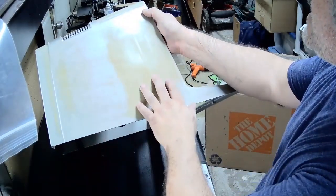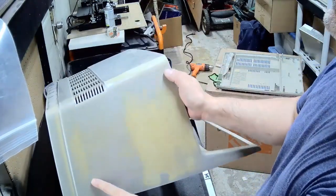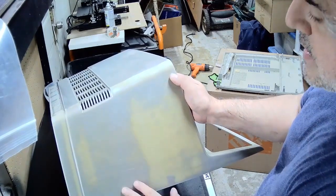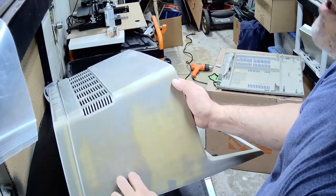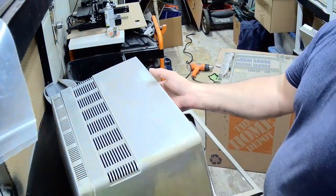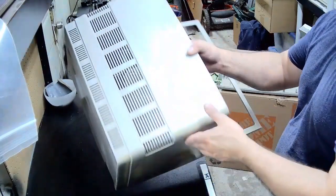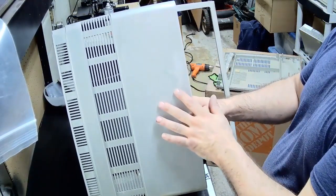Here, they're really, really deep. I had to go to the plastic. These are not deep. The scratch is to the plastic, but my sanding is not, and there's no surface to catch with your nails, so when you paint it, it will go away completely. Looks bad now, but once it's all painted, and this causes no warping, all I did is remove the paint off of it. Again, this big one here, same thing.